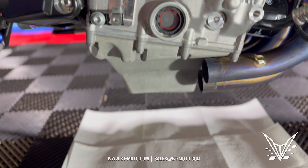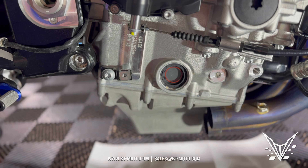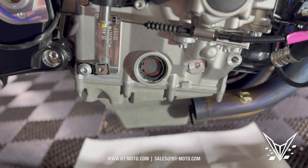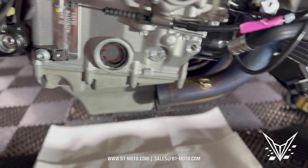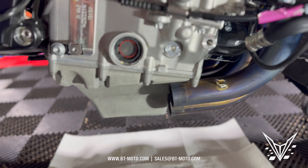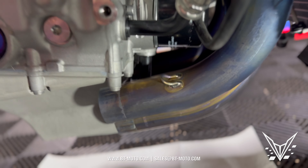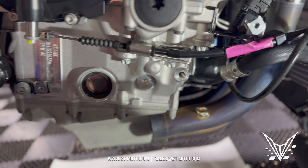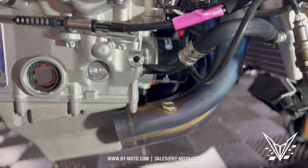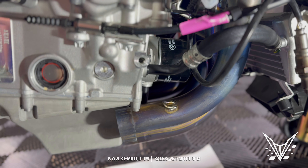Now that we have the oil drained, put the drain plug back in to ensure no more dripping, and put some towels down just to make sure when we pull these bolts out we don't get any leakage. These are T30 bolts and there are 14 of them — remove them around the entire pan. While you're doing this, make sure your bike is on a front and rear stand; it gives you more clearance and better angles for these bolts. The front ones are a bit of a pain. I also make sure I don't pull out the oil filter quite yet because it makes quite a mess — I'll save the oil filter for last.